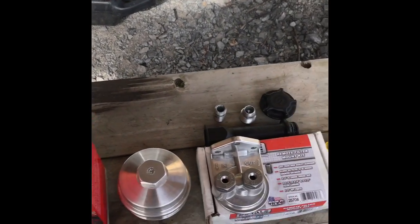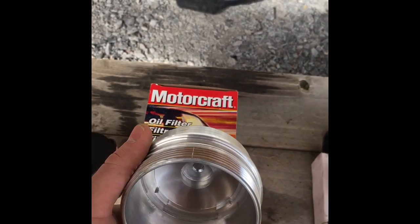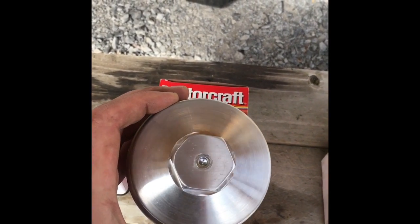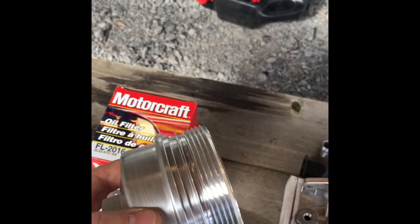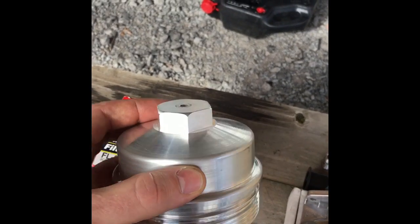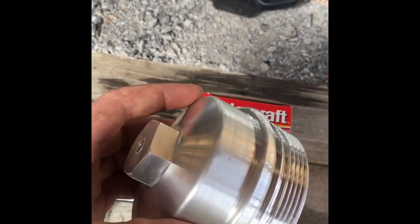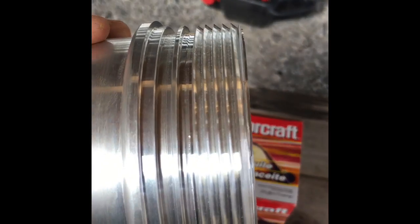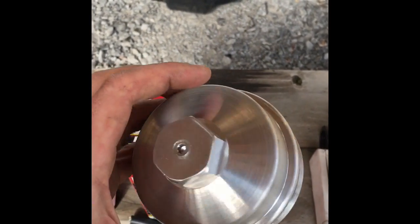First, the stock Ford Motorcraft filter. Next is an eBay oil filter cap — it's got a little 1/8-inch MPT bung so you can tap in and put a gauge on it or whatever. It doesn't look badly machined and it looks exactly like the OEM filter housing or cap, so we'll see how it works. If it really does screw up I'll go out and splurge for a good one. I'll put a link in the description about who makes this thing. The threads are decent but I had to touch up some of them. I didn't want to screw up the filter housing on the truck.